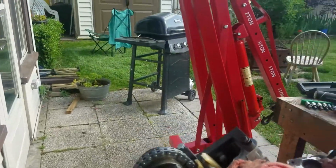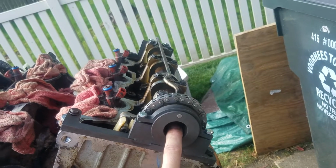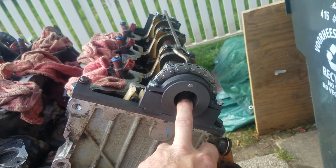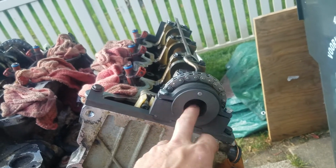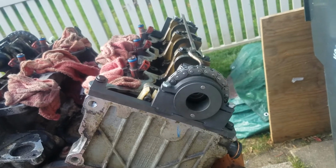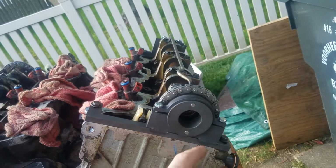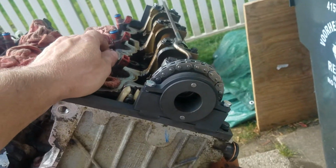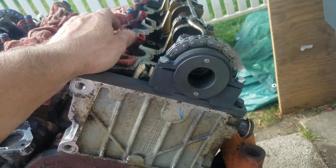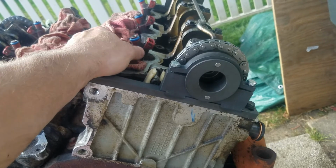I'm going to have to order it on those. And just so you know, if these things are worn out and you find someone else has been in there, more likely they've been over torqued. They weren't torqued right, and they're worn out, and they're not going to work ever again. I had to drill this one out. Luckily it came out real easy. As soon as I got a little bit into it, it just started coming right out for me. But yeah, just replace all the bolts. Just replace all the fasteners, for peace of mind.